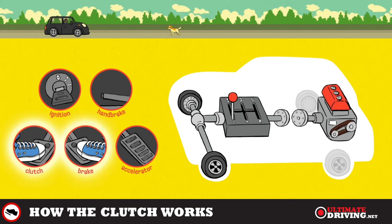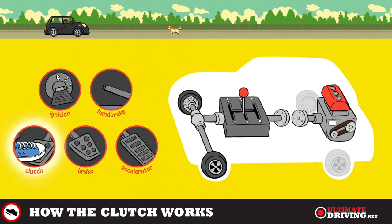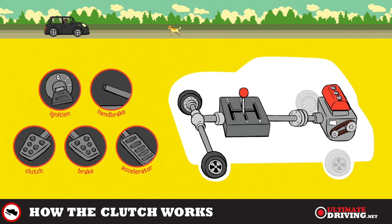If you've just stopped in a parked position, always apply the handbrake but press the button in — don't let it click. Put it into neutral and then you can come off the brake and the clutch, and if you're staying there for a while turn the engine off.